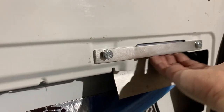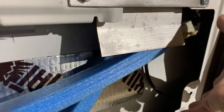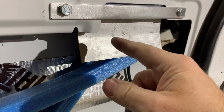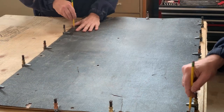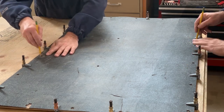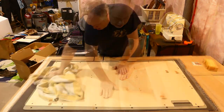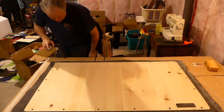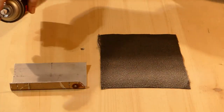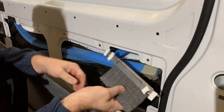This is done — super nice feel on the hands, you've got a really solid area to pull on, and this will be fabric covered. The plastic removed from the cargo van sliding door was broken and cracked all over the place, so I wasn't going to try to reuse it. Instead, I traced it on three-sixteenths plywood, then cut an opening for my new door handle. Here I'm gluing our Duramax dark gray fabric to the new door panel. For more information on the fabric and adhesive used, please see video 24, Van Walls. Here I'm adhering the same fabric to the inside of the door handle to ensure it looks finished. I've added a little bit of double-sided tape just to hold it until we get the bolts in.